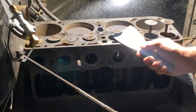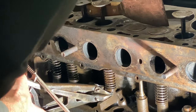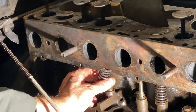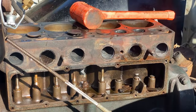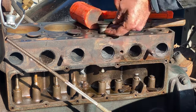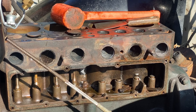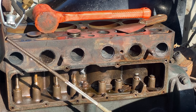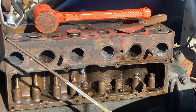Next I wanted to pull all the valves up so that the stems are out of the way so we can remove the springs. As you see here, it's just a matter of knocking the springs off center and out they come. The next day I was back at it — now it's time to remove the valves themselves. This nifty little tool hammers the valve guides out from the top. I'll put a link below if you want to get one for your own Model A. I've got to rotate the engine to get a little more clearance, but then boom — out they come.